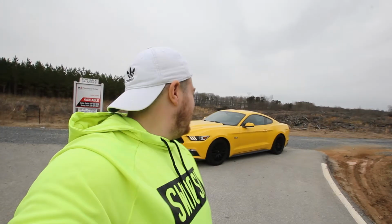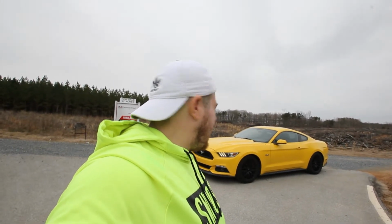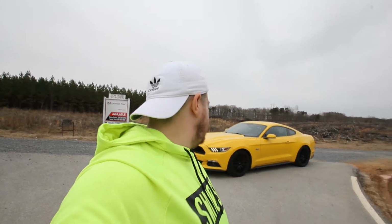They're 350R spec wheels. So I've actually got 350 fenders that we're going to be putting on the car to fit the fronts because they're 19 by 11 plus 24. And I'm going to be running 305/30 tires in the front and 325/30 tires in the rear. So it's gonna be meaty. It's gonna be real meaty. It's gonna be awesome. Then got a brake cooling kit for the Brembos and a couple small add-ons.